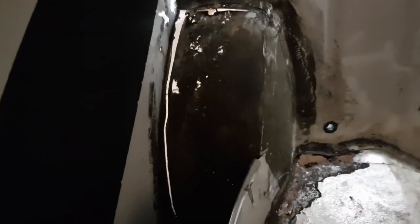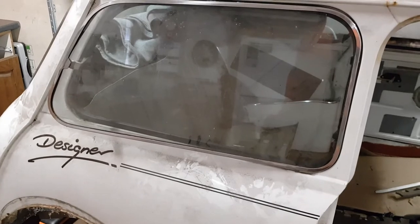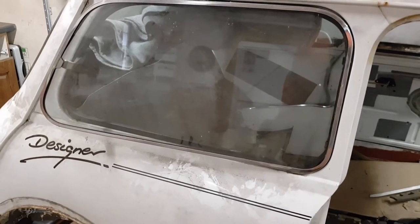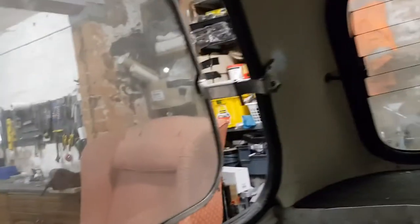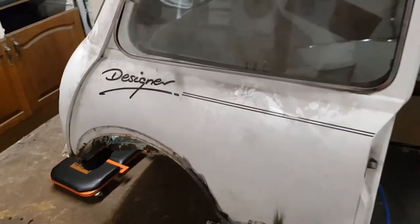I've started cutting on the inside but it's a bit slow going because of the double lip on the wheel arch - a double seam. With the air saw I'm going to need to get the grinder out, but I'm worried about sparks flying around inside the car. I think that window's got to come out anyway because when I'm welding the wheel arch I don't want to be right next to it. It's just a few screws at each end, so I'll quickly whiz that out - it'll make life a bit easier.